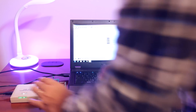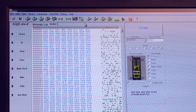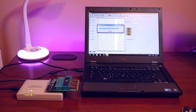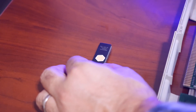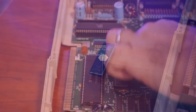To burn the image we place a 27C400 chip into the burner and load the patched Kickstart ROM we created. One important step many people forget: you must byteswap the image file. All EEPROM burning software should have this ability — if you don't byteswap the ROM, it won't boot. After about a minute our Kickstart is burned and ready. Make sure you put a sticker over the glass window, as UV light is used to erase these chips and too much light exposure can cause them to go bad.